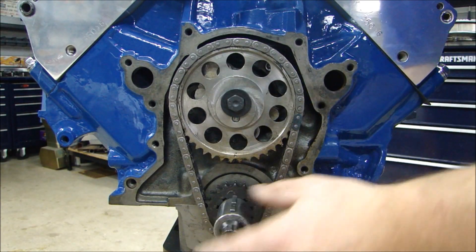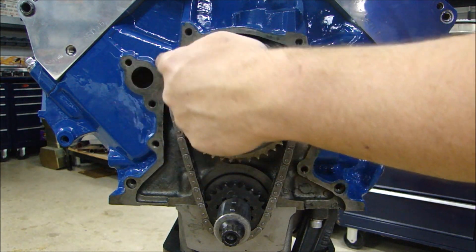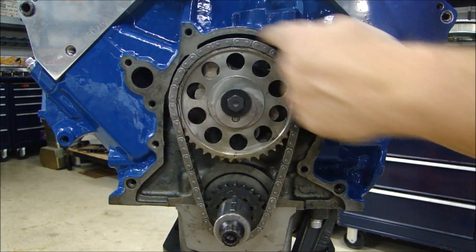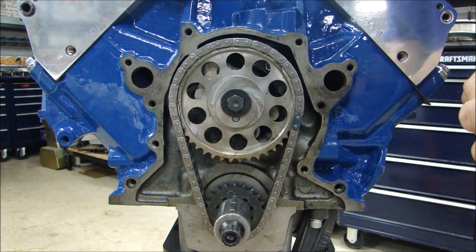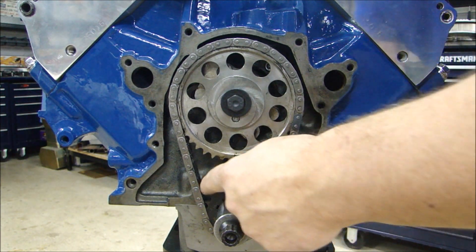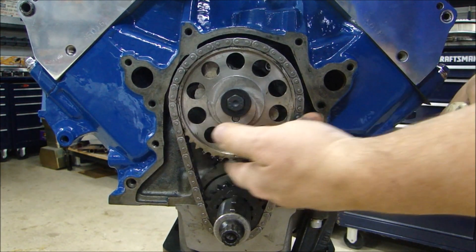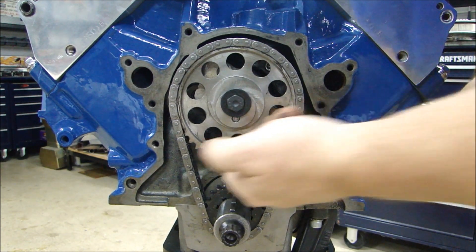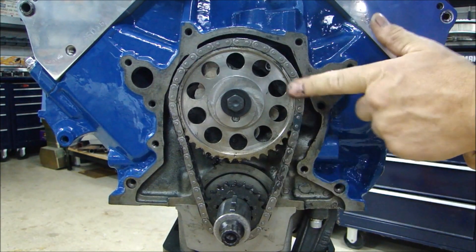What the front cover does — at least for this Ford, and Chevys are similar — is it has to seal two things: the coolant coming through these passages, and the oil around the entire perimeter of the gasket. The oil pan comes up underneath to seal the bottom. Before putting the cover on, I like to take a little bit of engine assembly lube and get some inside the gears and on the chain, so when you turn it over for the last time you have a little extra lubricant.